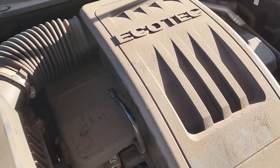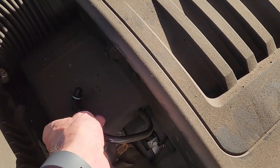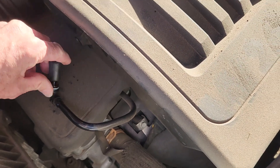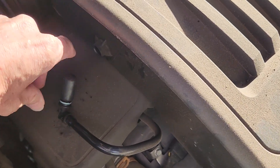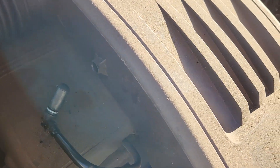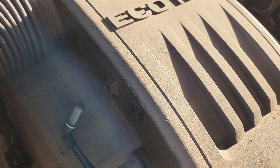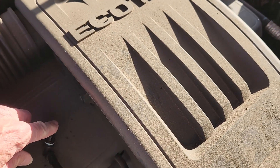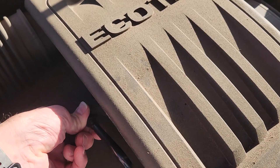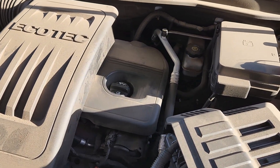I come over here and plug this port like this, and put this little cover on. You can hear the chirp, which supposedly means the system is working — definitely a vacuum on here. So my PCV system is working.